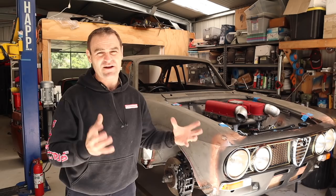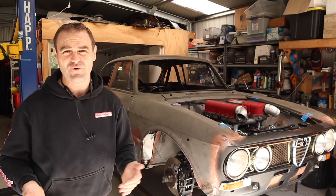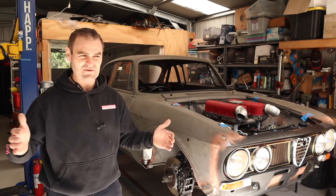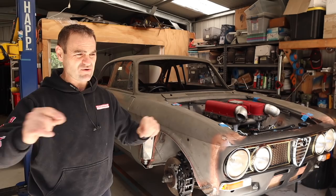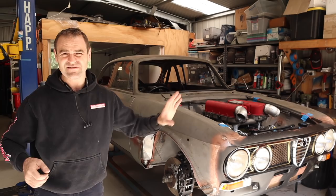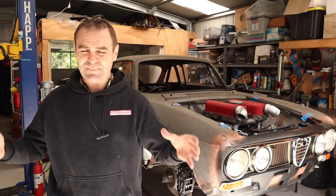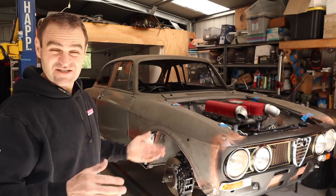I think it went really well. There were a couple of comments from people who weren't sure about only having two grounding points in the car, some saying there'll be more interference. Actually, the opposite is true — high-end motorsport looms generally try to share one grounding point so you don't get strange interference. It keeps everything in the one spot. People worry the loom's going to get hot, but I made sure the grounds are more than covered. It just means fewer potential issues later on, because so many car wiring issues end up just being bad grounds.